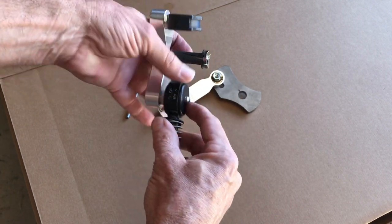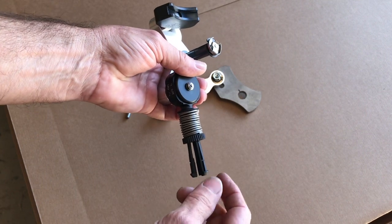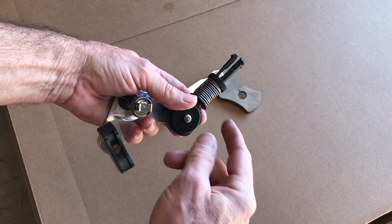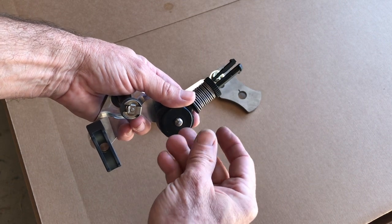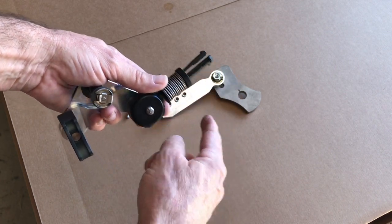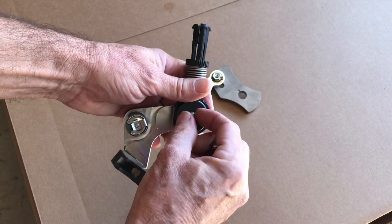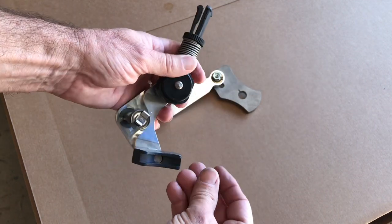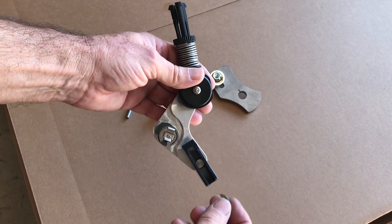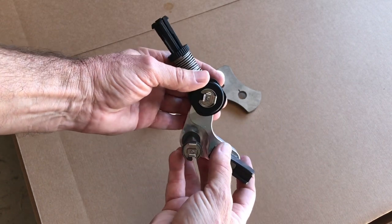The thing about this cable end is it has the ability to be readjusted very quickly — maybe one minute to adjust the shifter. Before, with the aluminum cable end, you would have to loosen the four clamping screws, do the readjustment, and clamp the screws down again, and they didn't really like to be moved once clamped because the aluminum is soft. The side to side adjustment is pretty critical and picky about where you clamp the cable. This way we have the ability to change the adjustment within about a minute, which will make a huge difference. Ask anybody who's already installed one and you'll realize this is a major advantage of the new version.